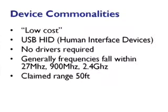All these are using what's called USB HID, which is human interface devices. When companies started making USB devices, particularly keyboards and mice, they didn't want someone to have to install drivers over and over again. Oh, this doesn't work in Windows 95 when USB came out, or this doesn't work on Mac. They wanted it to come from a certain standard and be able to work across platforms and across different operating systems. So they developed the USB HID standard. This controls how these types of devices communicate and what type of functionality they can provide on your system.